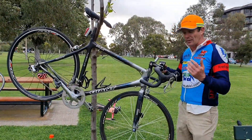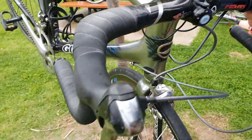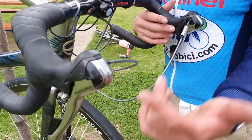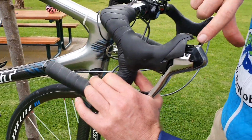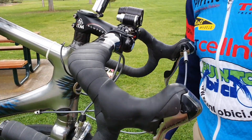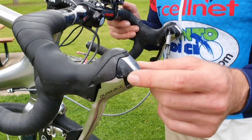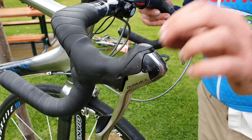We've got some 7800 shifters here. Natasha was getting a haircut and the guy was like, oh, you ride bikes — and he said if you can fix these shifters, we'll give you free haircuts. We gave the bike a full clean, a full gear tune, brakes tuned. We're going to change the front tire and tube. If your 7800 ones are a bit skippy, you can spray some solvent in there — don't replace them, you can refurbish them with some lube in there.